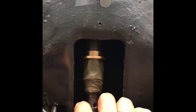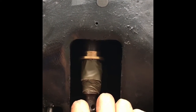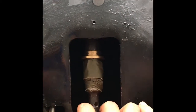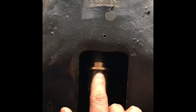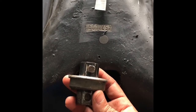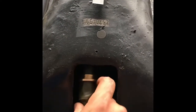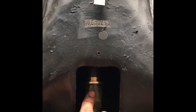I've tried other things — don't make the same mistake I made, that's why I'm showing you this. Just put some tape on here, I don't care if it's duct tape, just put it all the way to the end. It'll hold the gearshift bushing in place because you're going to end up pushing the rod all the way forward anyway. If you're thinking of skipping this step, you're going to have a headache — it won't allow you to push all the way forward to properly seat this. Just get some tape, wrap it around, it doesn't have to be pretty, and then push it forward.